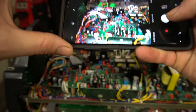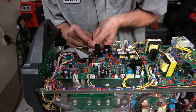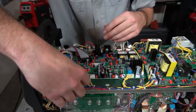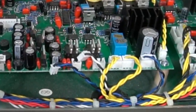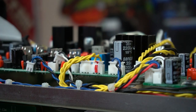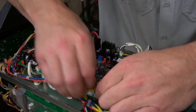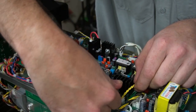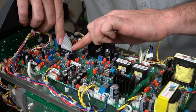Rather than trying to memorize where everything is, grab your phone and take very detailed and accurate pictures of the board you have to replace. That way you'll know exactly where every connector goes. Each one of these connectors can be a little tricky to get out, so very lightly pry up on them — just lift and they should snap right out. Now, if we look carefully, we have two connectors from the same harness that look identical. We can't get these mixed up because they have the same pin count. So I'm going to take a red marker and mark one of these connectors on both the male and female port, then go to the new board and mark the exact same port, so we will not get these two mixed up.